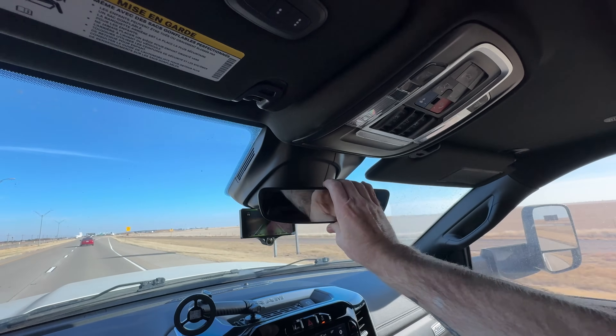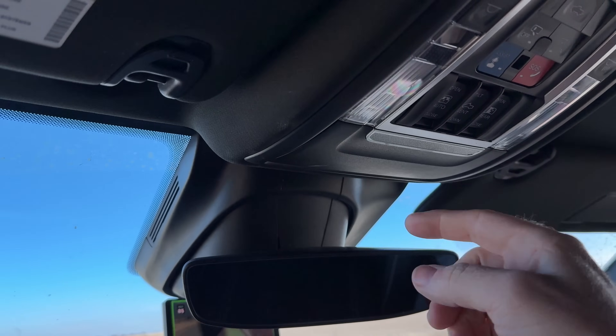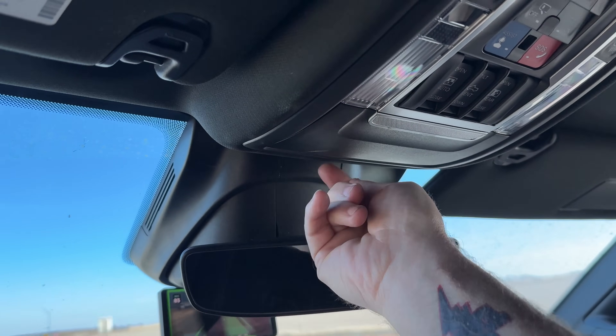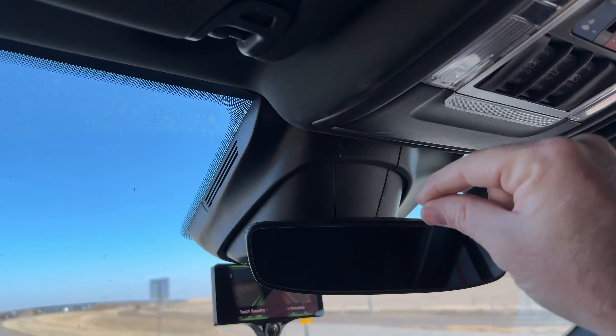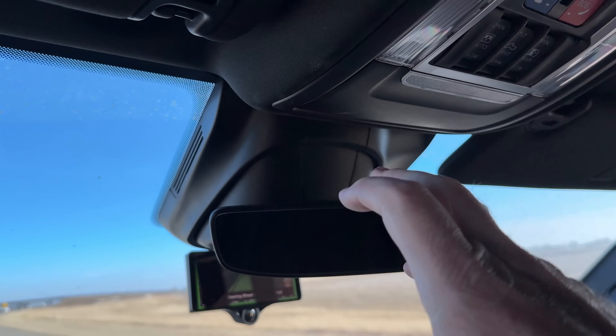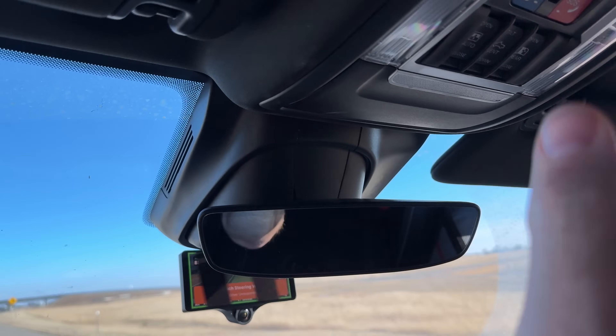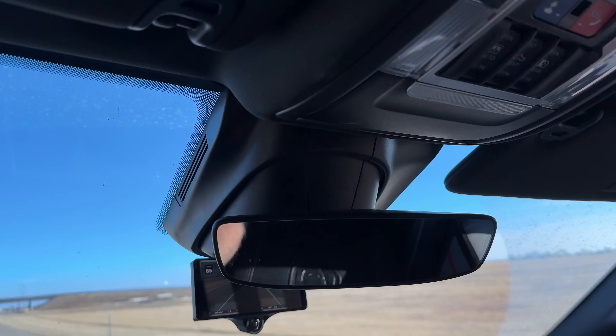Your mirror should not come off — just move your mirror out of the way as best you can. What you want to do is pull this panel outward. You put a trim removal tool up in there and pull it this way and then up. It has some little forks that go down there and the thing will slide up and out. That's what you need to concentrate on — remove that panel.